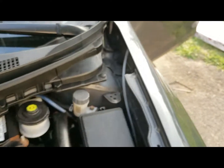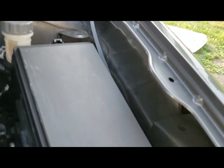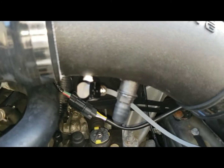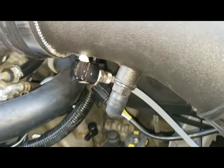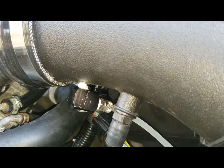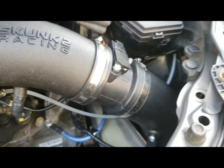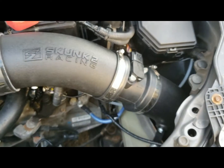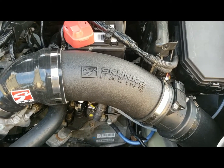So here it comes out — obviously it's not the cleanest, but there it comes. Comes out, comes under. And that's where I had to mount my nozzle, which was on the bottom side. As you can see there, it's drilled and tapped right into the bottom of the intake after the MAF sensor. Obviously you don't want any liquid spraying on the MAF sensor, because that's not good.